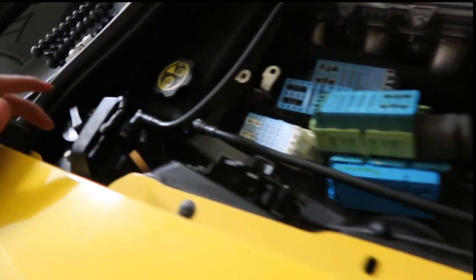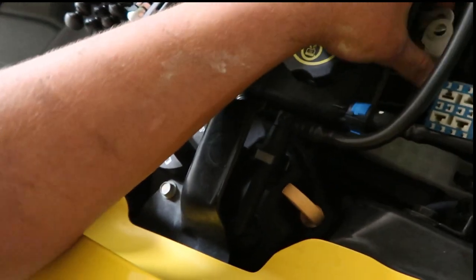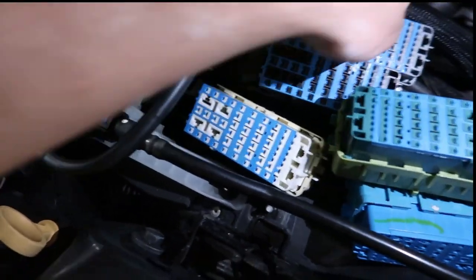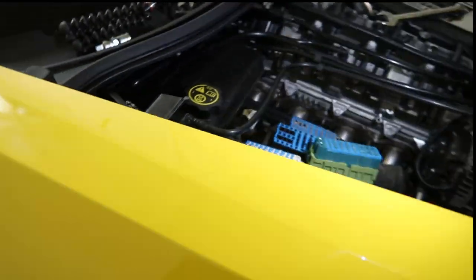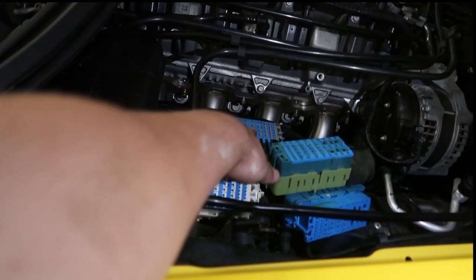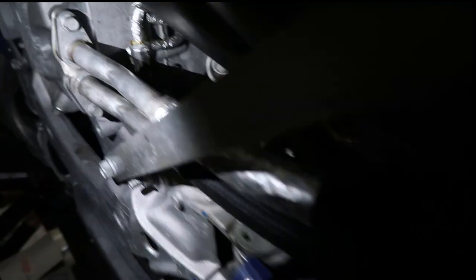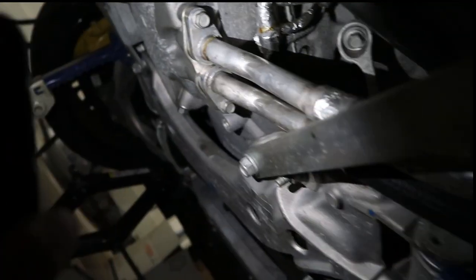I'm going to give you guys a quick rundown of how I did the headers. First things first: disconnect from the fuse box — it's just a 10mm or something like that. After that I took out the spark plug wires — not too hard, just be careful you don't mess up the wires. After that I just loosened up the bolts there to have them already loosened up. Next thing was loosening up this brace so I can get it out of the way, and also removing these lines up here. Oil will fall out of them, so have an oil pan ready.